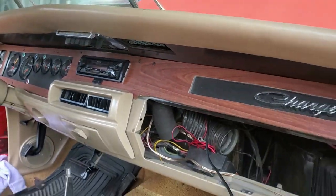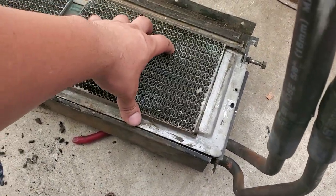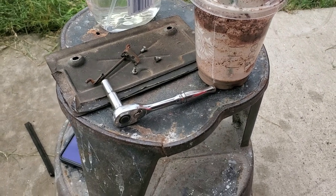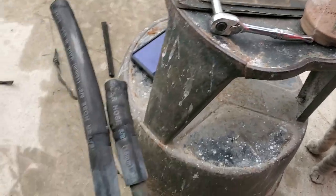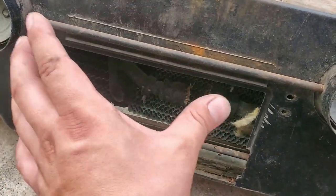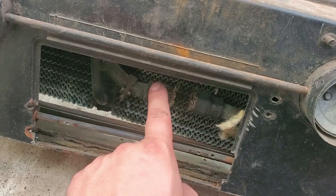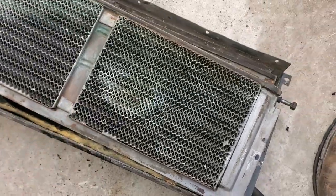Let me now give you a view of the insides of this. If you've already gotten to this point, you're gonna wonder how to take this off. If we flip this over, you're gonna have this little window — I pulled it off and it's right up here. It's got four-millimeter screws, so you take those off. There's also a little lever you're gonna find in there. Once you pull that window off, you now have access to these hoses. There are two hoses in here, and you can either cut them off — since you're already here servicing it, I would cut the hoses off and just put brand new heater hose in there.